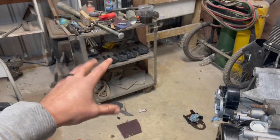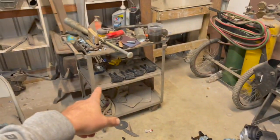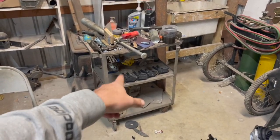This is one of those dumb things that I do, like the oil in the rockers or whatever, just stuff like that, I keep mine in order. Whatever order I take the coil pack off, I keep them in that order. Do you have to do that? I don't think so. A coil pack is a coil pack. They're not specific to any cylinder. That's just one of those things that I do. And so that's the driver's side, front to back.